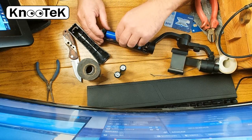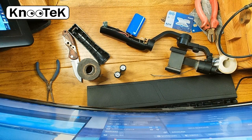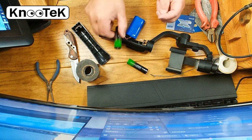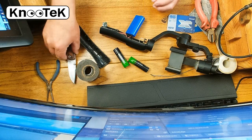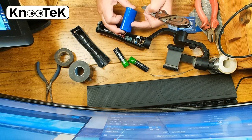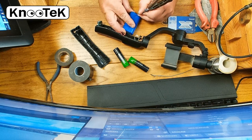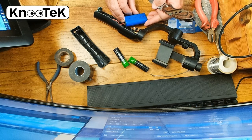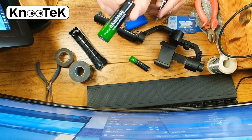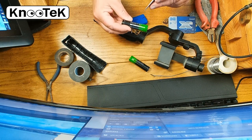That is obviously the battery. Inside here there should be a charge circuit. This battery pack is literally two batteries inside. I'm going to run my knife down into the heat shrink to open it up. This battery says it's 2000 milliamp hours, whereas the new ones are 9800 milliamp hours - so the new ones are almost five times the capacity.